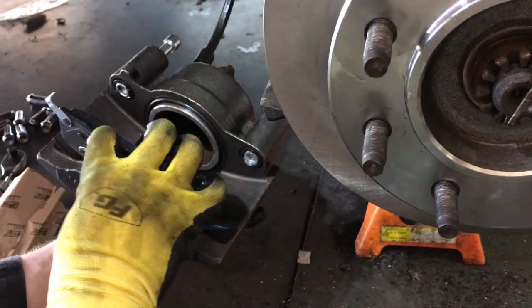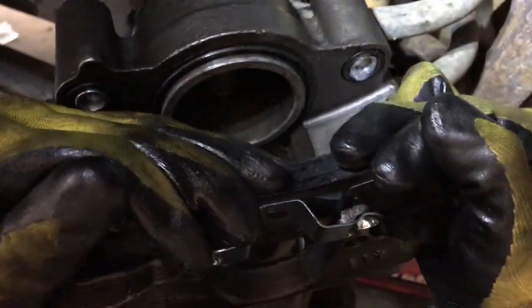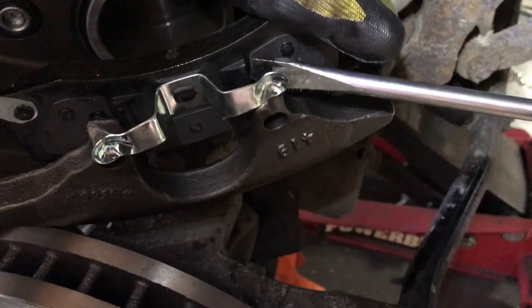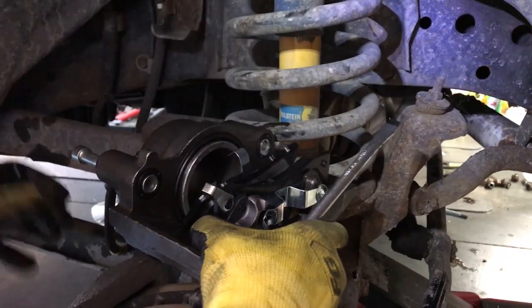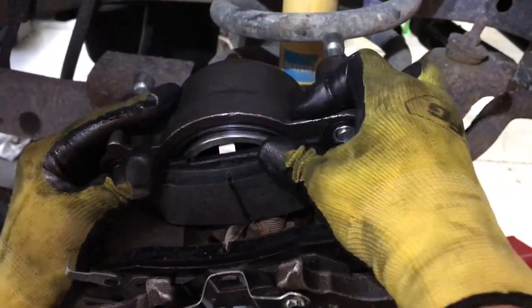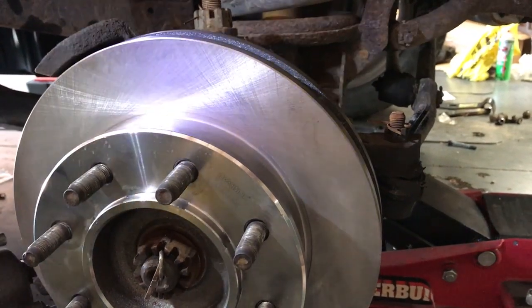Okay, the brake pad just snaps in here. These little tabs just snap right down on the outside of the pad. Pop that on, and we'll pop the other one on. There we go. At this point, get the brake cleaner on it. Remember, it evaporates really fast. Clean that rotor nice so it's oil-free, get the backside, and then you're ready to put the caliper on.